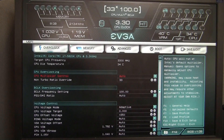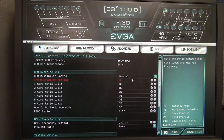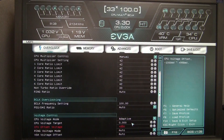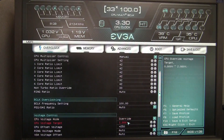All of these motherboards ship with EVGA's new GUI BIOS. This BIOS allows you to overclock and monitor your system vitals. You can see it shows you your memory, your CPU voltages, memory voltages, PCI Express slots, various temperatures, and I'm running a 33X multiplier with a base clock of 100 MHz. Overclocking on the X99 platform is very easy — you can do it in just a couple of steps by simply changing your CPU multiplier and adjusting your CPU voltage if you need to. EVGA does allow you to select an adaptive or override mode for your voltage. For example, you can set an adaptive with a 250 millivolt offset, or set an override setting which sets a more absolute voltage value.